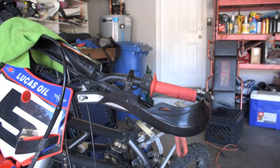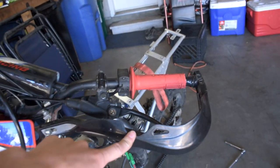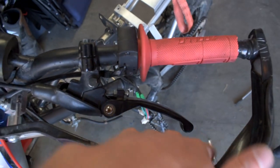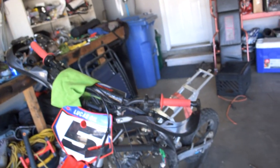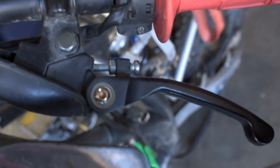This is a really great tip for all my enduro riders, or anyone who rides in trail systems where you might have trees, or maybe you just want to protect your hands, your clutch lever, your brake levers. A really great and cheap way — another $20 mod — is a set of hand guards. They protect your hands when you're holding the handlebar. This is going to be what hits a tree, and if you drop the bike, this protects your lever so it's not being dug into the ground. So you spend $20 on these instead of constantly buying $40 brake levers.